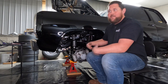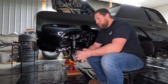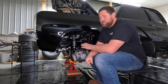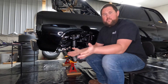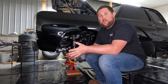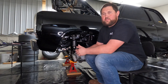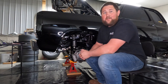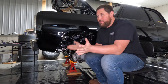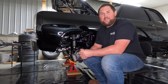Caster trumps pinion angle up until the point where pinion angle becomes an issue, so you might not be able to get to seven degrees of caster, and you're probably not going to get to negative one or two on the pinion angle either. That's a lot of important information on the front axle. On the next video we'll cover camber, toe, and steering ratio. Like always guys, thanks for watching — drop a comment with any question and I'll answer one on every video going forward.